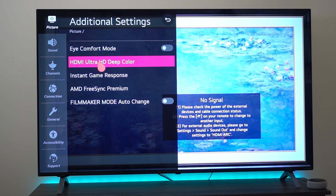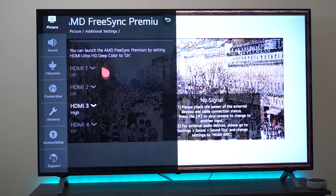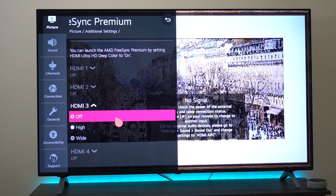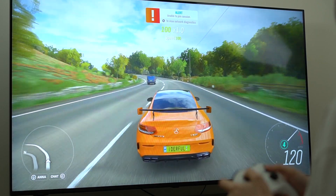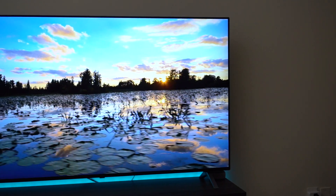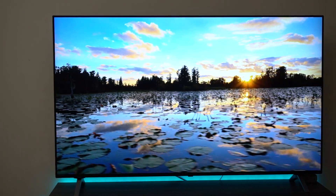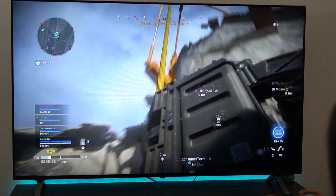Let's move into the gaming features. It has AMD FreeSync Premium, which is a type of variable refresh rate. This is going to eliminate screen tearing by matching the console or PC's frame rate to the TV. While you're playing a game, frame rate always varies — it could be 66 FPS, then jump to 72. When it's not in sync, it will cause screen tearing. FreeSync Premium eliminates that, so having it on the NanoCell 85 series is a really big pro. Not a lot of TVs have it, and it does push them ahead of other TV manufacturers.